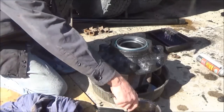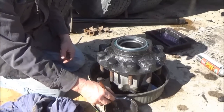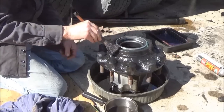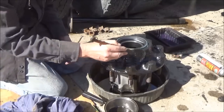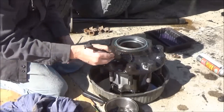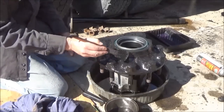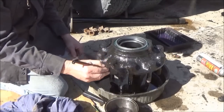I'm back on this thing the next day — Sunday. I'm going to play hooky from church so I can finish this. I'm going to clean it up with some gasoline and a brush. If I don't clean it, then I won't know if I have a problem again until it's too late. But if it's clean and dry when I put it back together, then just the slightest little leak, I'll be able to see it starting already.